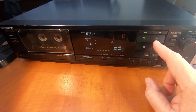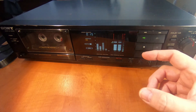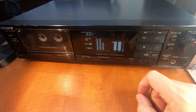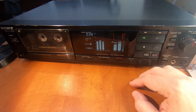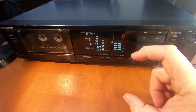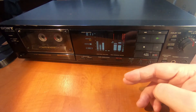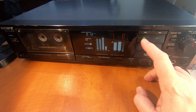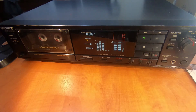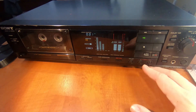So there's your reverse. The soft touch controls on the Sony decks are all a bit clunky because they're operated by a solenoid. The solenoid replaces the action of you physically pressing down the button on a non-soft touch deck. So that noise you can hear — that initial clunk — that's that large electromagnet actuating the mechanism. Then there's a secondary noise, which is the play head spinning round on this turntable. This deck has bias adjust and all your usual stuff.